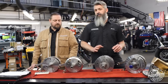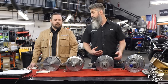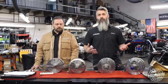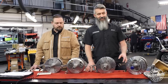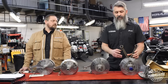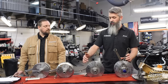Something else in your motor build: if you're getting a custom pair of pistons done, they're not typically the same exact weight combined with your piston rings, clips, and pins as a factory piston. So typically when we do a custom pair of pistons with a dome on them, if they weigh different, we have to pull the flywheel out to make it match your pistons. That's really what blueprinting the motor is — getting everything balanced correctly. If we're already doing that, that's when we add these upgrades. If we're just putting on an S&S kit matched to factory Harley specs — like their 128 kits — we can take the stock flywheel without pulling it out of your lower assembly, saving labor, time, and money on your build.